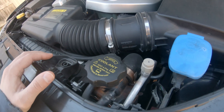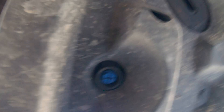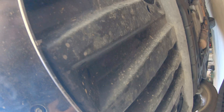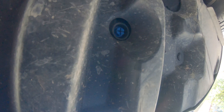This is pretty straightforward because there is a radiator drain plug on these, which is under here. And there it is. That's really handy — that means I don't have to undo any hoses or deal with plastic speed clips and whatnot. It's just this blue thing here, which is awesome. So that's a win.